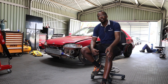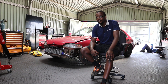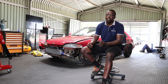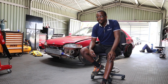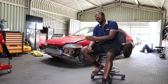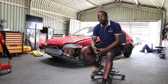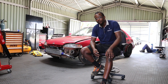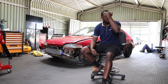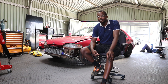The reason for that is just planning ahead, because this is something in development and we are likely going to see bigger power coming out of this thing later. Those older-style HT lead-type coil packs may not allow us to rev higher — I think this one has got a single coil pack, so we may run into issues where we need a coil pack that's able to run shorter dwell times, for us to be able to rev higher if we're chasing higher RPMs such as 7,000, 8,000 or even more, depending on what this engine can actually handle.